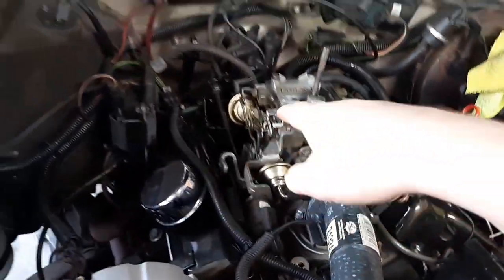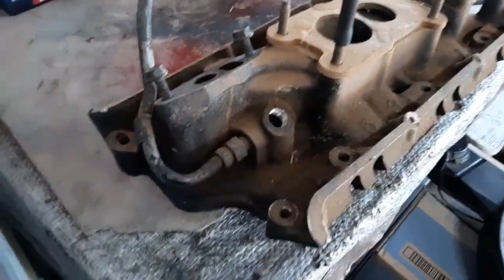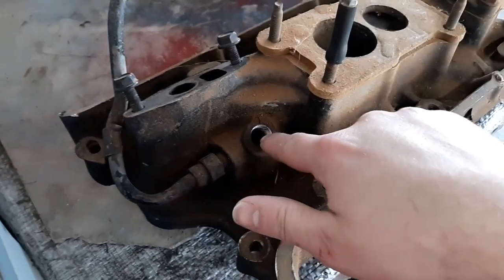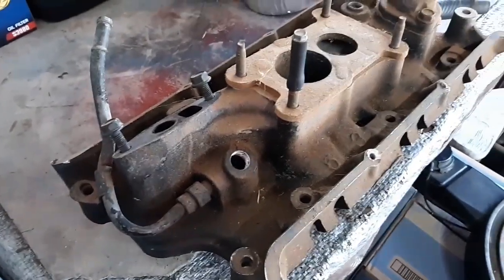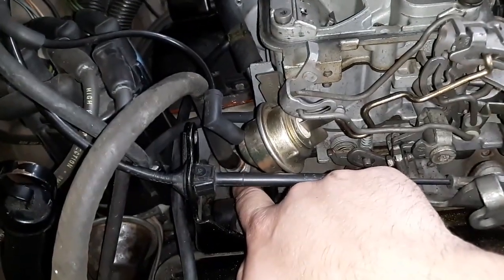And the port over here at the back, I'm just going to show you on my spare intake that I got, because it's better this way, better lighting. So I took the cap off, EGR valve I got from this one. They had a cap literally on that intake on that engine right here. There's supposed to be a nipple sticking up to where it gets vacuum to the HVAC inside the truck itself. So when you turn on your AC or your heat, whatever, defrost, it gets vacuumed to open up the blend doors inside the dash. Well, they in fact had that guy capped off. So I put the one back on here that's supposed to be on here.